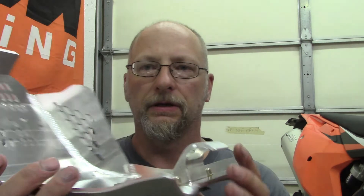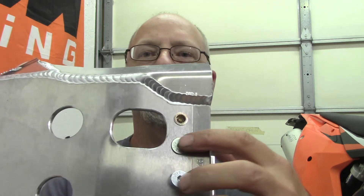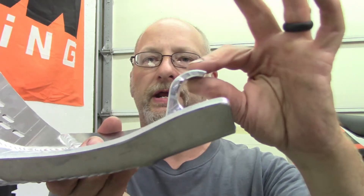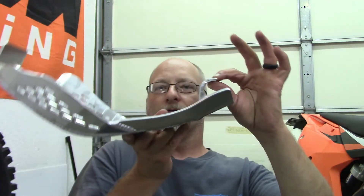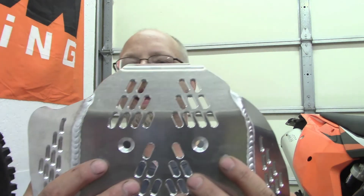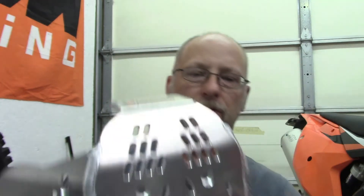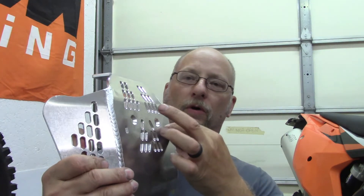What it is, it comes like this. You have to bolt this little hook on - there are two hex bolts that you thread into this little piece right here. You get that started and it will hook up over your frame, then you'll bolt it through here. On a 350 EXCF, you have two factory nutserts in the frame that will bolt right here - you can put your bolt right in that hole and bolt it up.